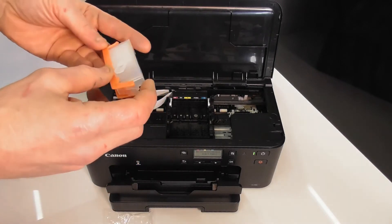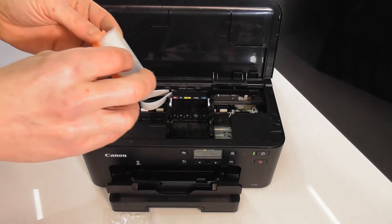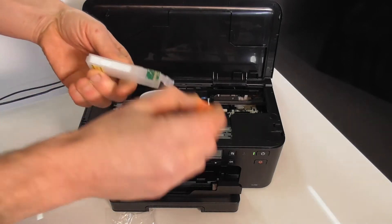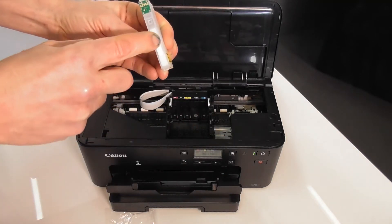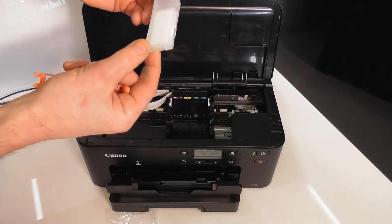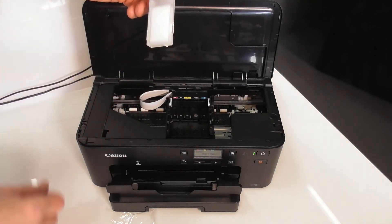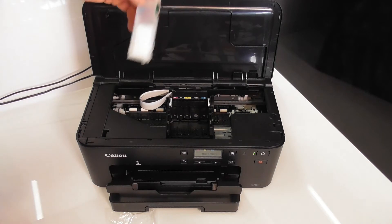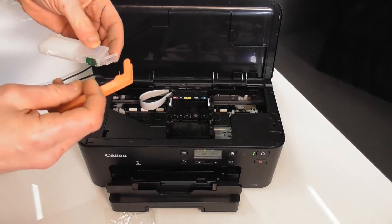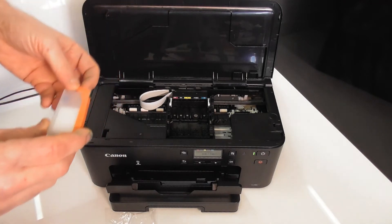Whether you have to fit this or not, you need to refer to the instructions. The purpose of the silicone seal is — if you turn the cartridge and pop the cap off — it's to avoid minor imperfections from the mold companies in China where there's a slight possible deviation around the bottom. By putting this seal on top of the seal that's already there, it basically closes an airtight seal so there's no air drawn in and you get a good quality print.